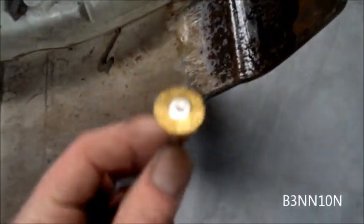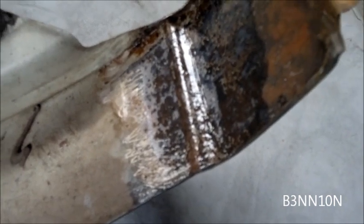I used the Dremel multi-tool and then tidied it up with a wire wheel and wire brush - it was quite difficult to get in the gap. I've painted lots of Genolite in there. What Genolite is - it's a rust remover, it will just eat away any of the remaining rust and it'll turn it black. Got to give it about 15 minutes, and because of the area I may rub it down or get the wire wheel back in there, then paint it again. Hopefully after about 15 minutes that area will be really black and the iron oxide will have reacted.